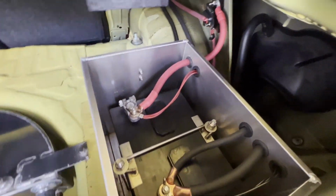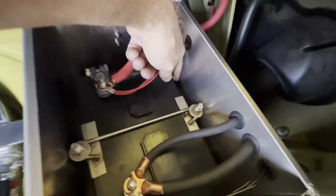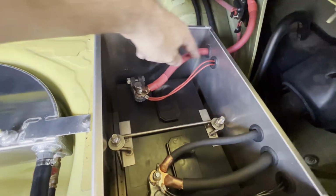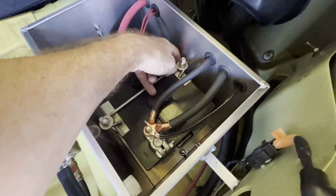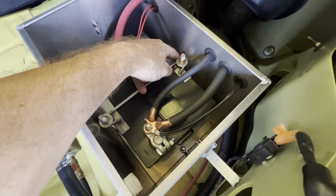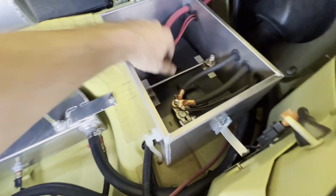And then the cables come in on top instead of down the side. That other one, those cables come up the side and you gotta try and turn them in over there. These just have terminals on top, just drops right on top, super easy. And these nuts, the bars down below have studs welded down, so you can just spin these off without having to get under the car and hold the bottom side as well.